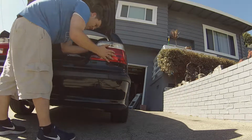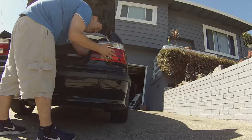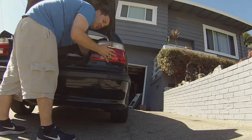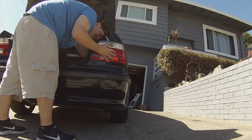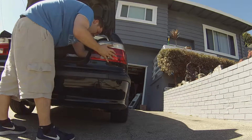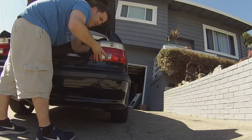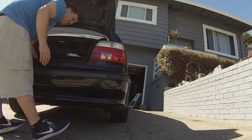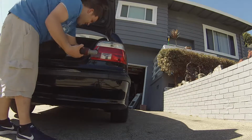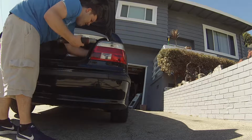Push, finger tight. 8mm screws. Remember, don't drop them. The washer's kind of built in-ish. Best way to describe that. Well, at least the ones on my car. I don't know what's up with your E39. Who knows? You can pretty much finger tight these things in, but I'm gonna hit them with the torque. Sorry, not torque, that's improper. This Milwaukee Badass puts out like 125 foot-pounds torque. Just melts these bolts in, but you know what? They stay. So.